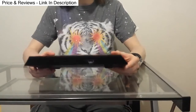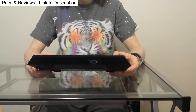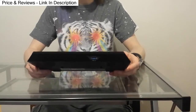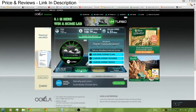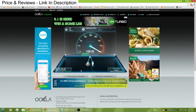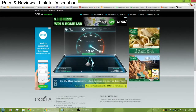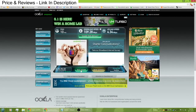Next, we will be doing a speed comparison with a wired connection to the computer using my previous router, which is a WNDR 3300 — it's kind of old — and then this bad boy. We'll get started with the wired test first to get a basis for the speeds that can be expected from the routers. First, let's look at what a wired connection directly from the modem to my computer provides. I am using a five-foot gold-plated cat six wire to ensure optimal speeds.